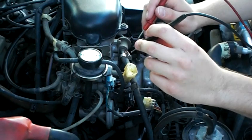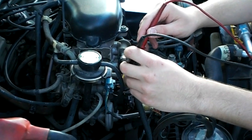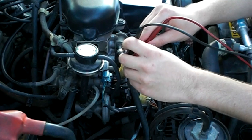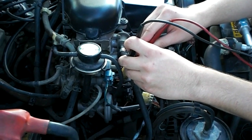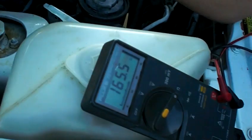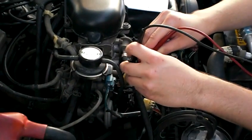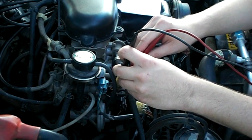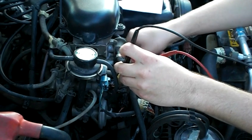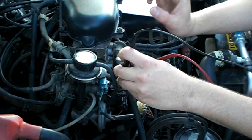Now I look at C and D. It's closed all the way so I'm not going to get an exact reading. I got 1.165 on C and D. But if I open the throttle to 0.2 or 0.4, that's where you have to turn it just a tad. Once you have it calibrated, you have to turn it — mine's not loose right now, but you turn it just a little.